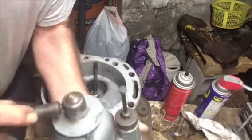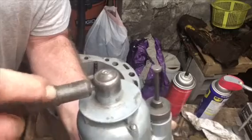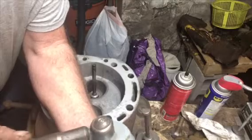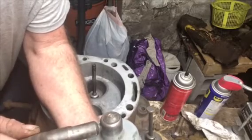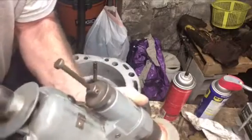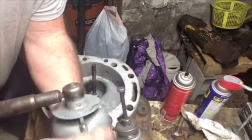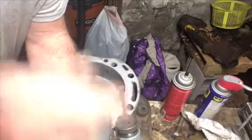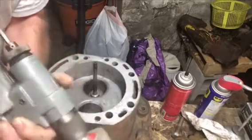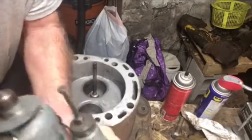If you look here, it says A and B. And there it says V8. That's how much spring pressure you should put against there. If it was a Ford Model A or B, you just put that much spring pressure. If it was a V8 where it hung more to the side, that's how much spring pressure you should put against it to counteract the weight off to one side. So anytime when it's straight up and down, you just hold it about at the A and B mark.